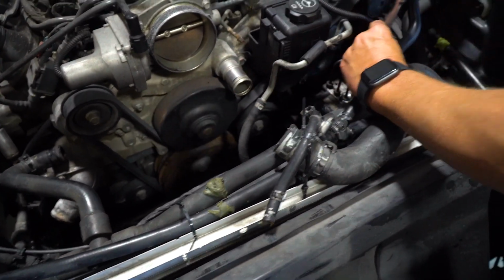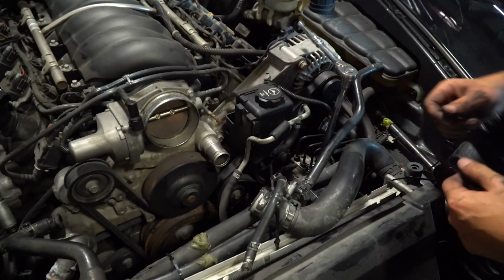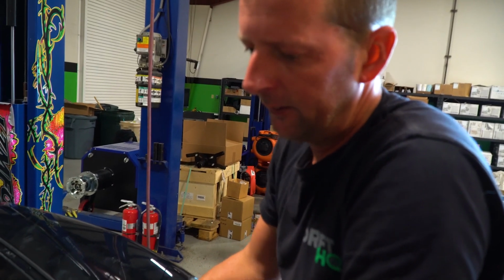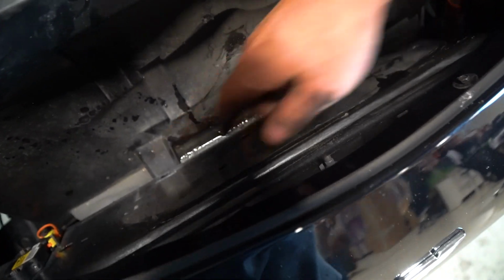And obviously the little intake. Yeah, intake we took off as well, which was easy. It was just a little flathead screwdriver. Disconnect that. You have a MAF airflow sensor, and that was it. Just 2 clips in the front right here that you just had to pop out with those things the devil made that Chris talked about earlier. Little plastic clip. Those ones.